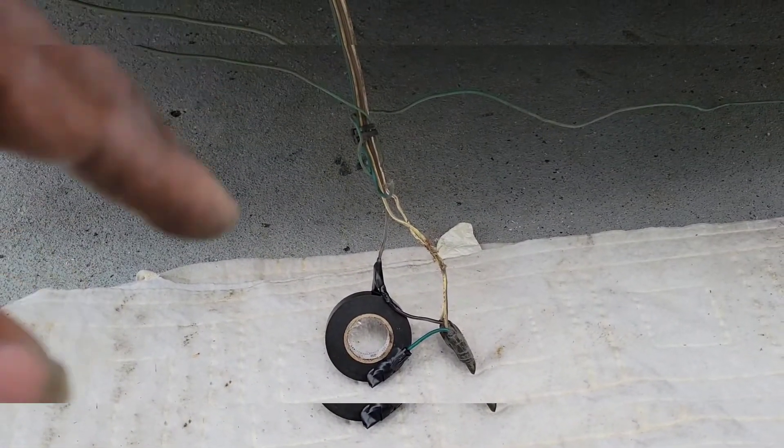And so that's how you troubleshoot an electrical system. I had my test light out, I had my multimeter — I was checking to see if there was power to the socket. I took the light out, the bulbs were fine, but there was no power to the sockets whatsoever. What it was is frayed wires from the bumper hitch rubbing together — this connects to a light cord and is still active and connected into the lights for taillights, brake lights, and signal lights. So I'm just going to tape all this up, put that 15 amp fuse in, and we'll be good to go.